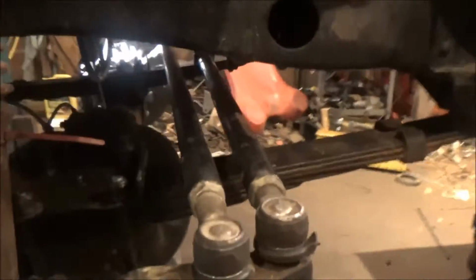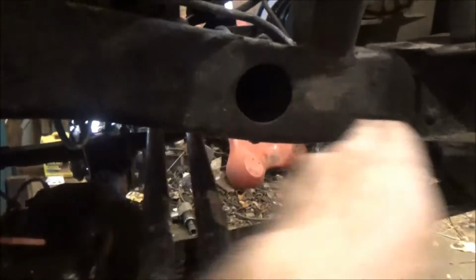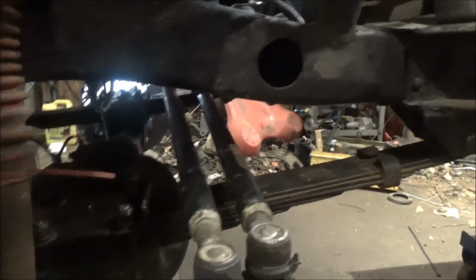Oh, we're also going to do some traction control for the front, and what I think we're going to do is a triangulated mount up off of the spring plate and a set of link bars that go to heim joints or urethane bushings at both ends to control it. So that's where we're at with this thing.